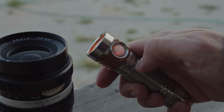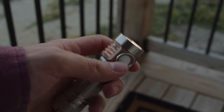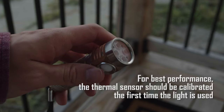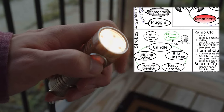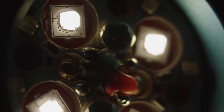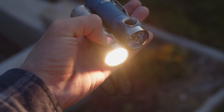Muggle mode settings will be remembered even if the battery is removed to ensure safety. The light has a built-in temperature sensor and intelligent temperature control, but the maximum target temperature can be adjusted by the user. There are several strobe and blinking modes with adjustable rates and output, a sunset mode which gradually decreases output with a configurable timer, and a mode which flickers like a candle and can be set to shut off on a timer. One of my favorite features is manual mode memory — by default the light remembers the last used mode, but pressing the button five times locks a specific level into memory so it always defaults to that output from off.